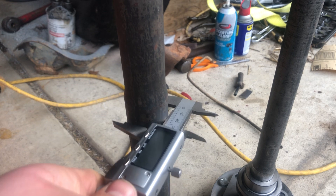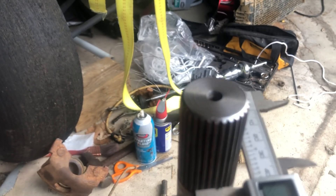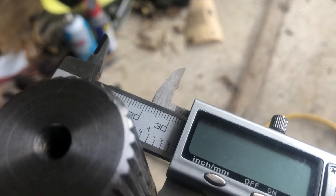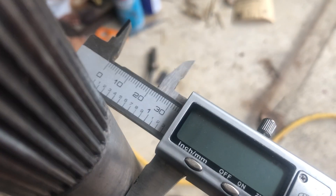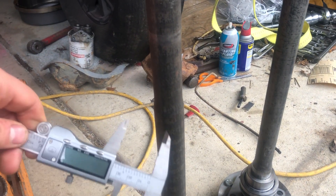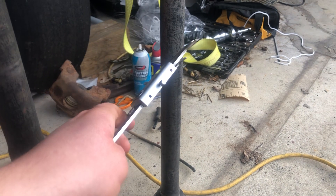It tapers down right here for whatever reason. And this is the 31 spline chromoly — the actual diameter is just under 35 millimeters all the way around the tube, just under 35 millimeters. And this one does not taper. What is interesting about these axles is the 28 spline tapers down to a thinner, less stout shaft, but half of it is the same thickness as the 31 spline.